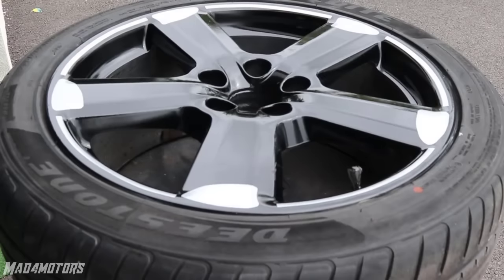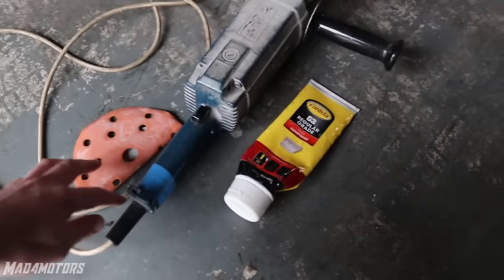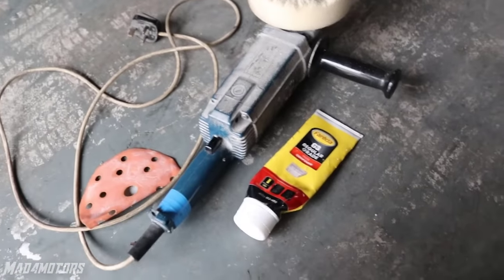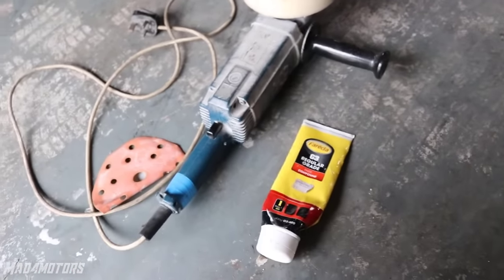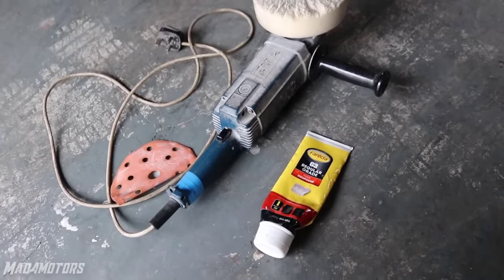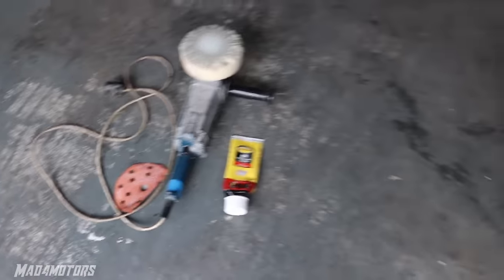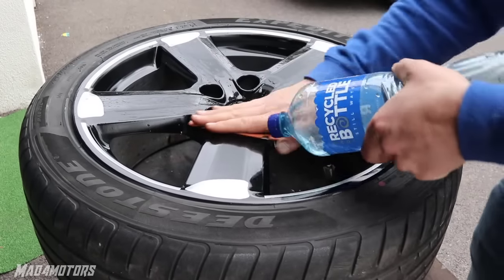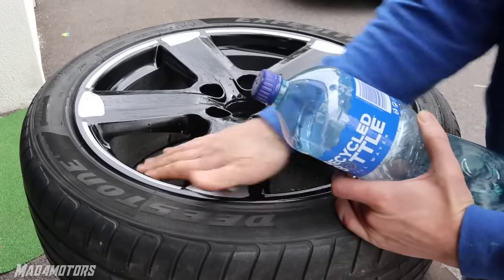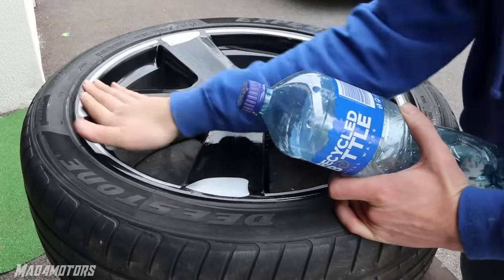It is the next morning and the clear coat has been dry overnight. There is some slight orange peel in the wheels so I have decided to go ahead and wet sand and buff them. To do this I will be sanding down the wheels with 2000 grit sandpaper and then applying some G3 compound and buffing the wheels. The one thing you have to be careful with when doing wheels is not to burn the clear coat — because of all the curves it can be quite difficult to buff them. Because of the curves there is no possible way to use a sanding block so I am sanding these with 2000 grit by hand, not spending much time in one area to eliminate the possibility of going through the clear coat.